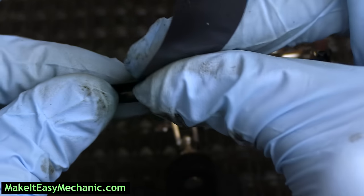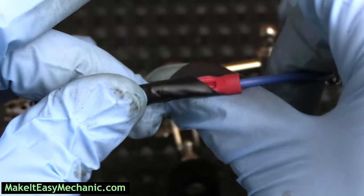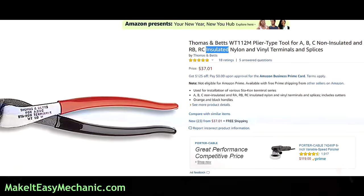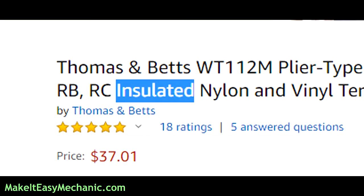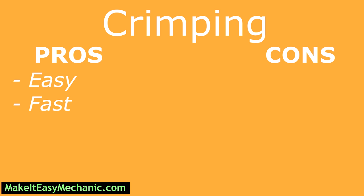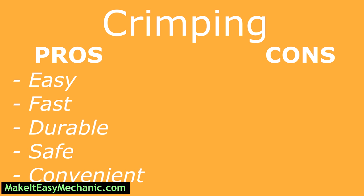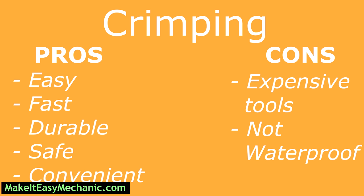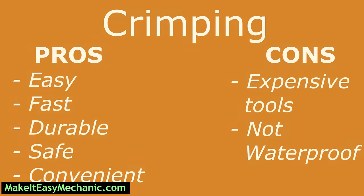I personally prefer to wrap the repaired area in electrical tape afterwards to add another layer of protection. If you need to use heat shrink butt connectors, make sure to use a crimping tool designed for insulated connectors and terminals, otherwise the insulating tube can get punctured and when you heat it up to shrink it the puncture will split open. In conclusion, crimping is easy and fast. Some argue it has superior mechanical characteristics to other methods if done right. It involves fewer harmful or dangerous processes and works well in limited spaces. But to make this a quality repair you want to use quality tools and connectors, which can be expensive. Vinyl insulated butt connectors are not waterproof, therefore repairs are prone to corrosion.